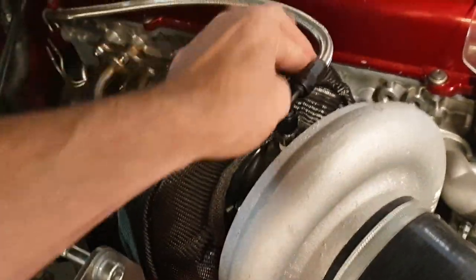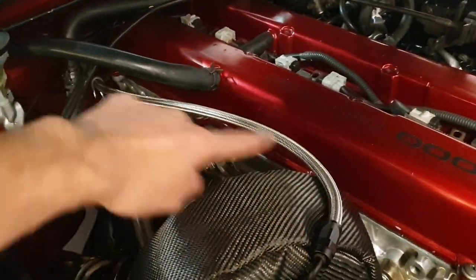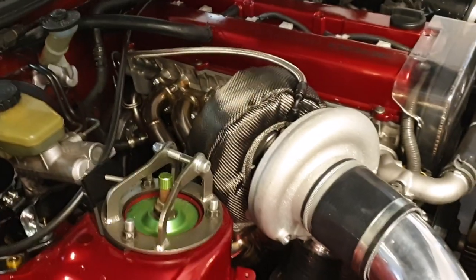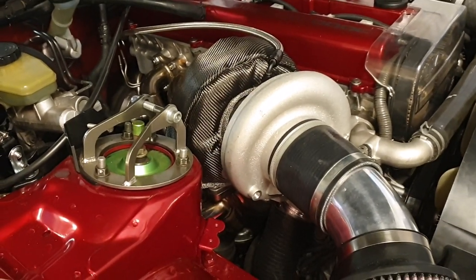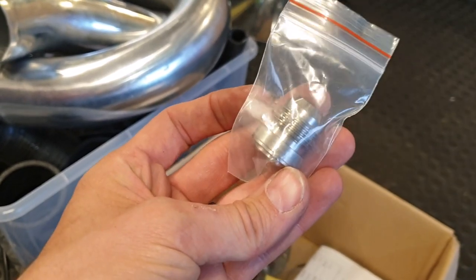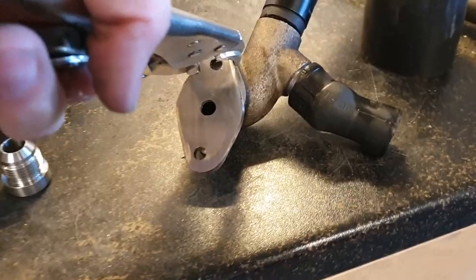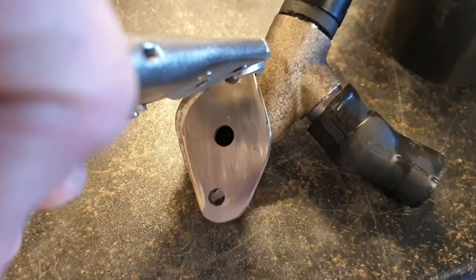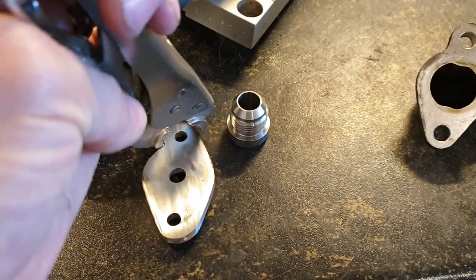Here's one I prepared earlier - it's on. Yeah, that fits quite nicely, it's quite snug on the turbo. I've got a Funk Motorsport heat-proof cover coming for that, and one coming for the drain as well. I've still got to make up a drain and mount to go to the sump, so I'm going to take off the sump drain now and then I can start copying it. What I've bought is an AN10 drain connection - it's quite nice, a block of stainless steel. So fairly cheap and it took me probably an hour and a half to make that up including drilling the holes. Still got to open up the big hole.